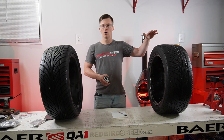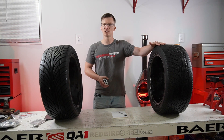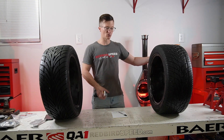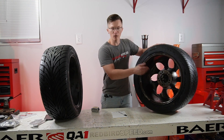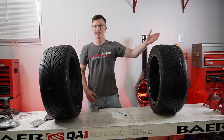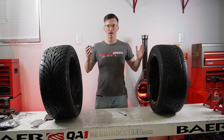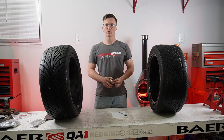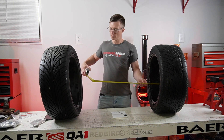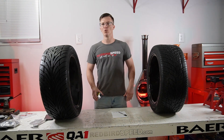What we like to do is get your rims and tires that you want to use, stick them up in the wheel well, and measure from wheel mounting surface to wheel mounting surface. That's the backside of the rim where it's going to hit the hat of the rotor or your drum brake. Mock it up, get the wheels in the wheel well where you want them, and measure from where the wheel meets your brakes to where the wheel meets your brakes — wheel to wheel.